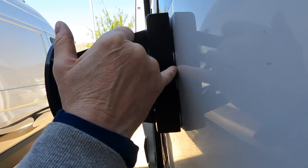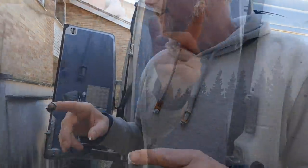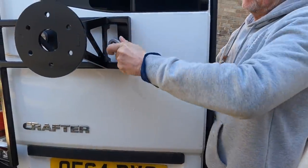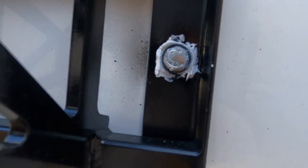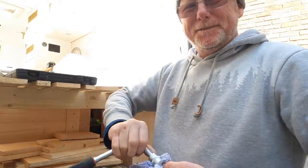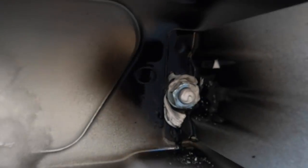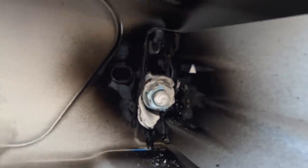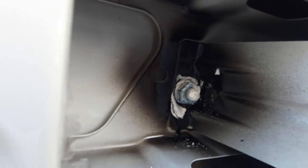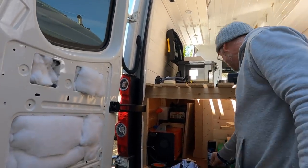You can see a blob of mastic now between the wheel carrier and the door — squishing it with fingers both front and back. Look down the gap — you can see it's in that gap. The bolt is 17mm socket, 17mm spanner, 10mm bolt — nice and sealed. Nothing worse than a dirty tool; wipe them clean after every use. There's the bolt on the inside, completely and thoroughly masticised as well as painted — nothing's going anywhere and there's no way any water is getting in. Panel's going back on.